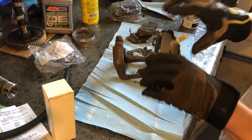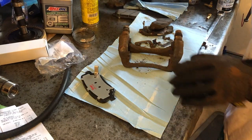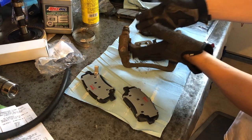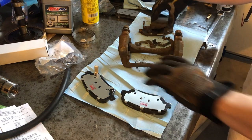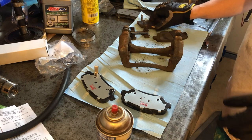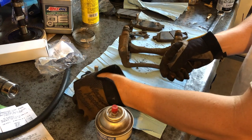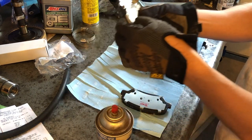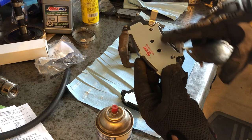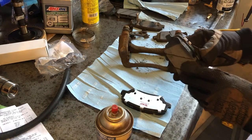We have our new pads right here. Now to prevent brake squeak, you can spray the new ones — when you spray them they're less likely to squeak because there's an adhesive that makes them actually stick to the caliper so they don't rattle around and cause a squealing noise. This one had a factory shim, and we can actually reuse it. It's not a bad idea to reuse factory shims because they help quite a bit with brake squeal. You can see there are two tabs that line right through the shim once it's placed on.